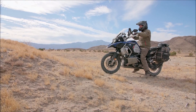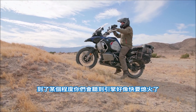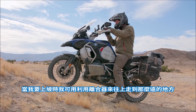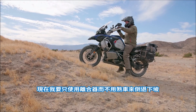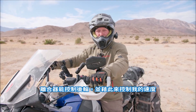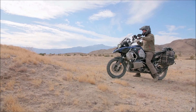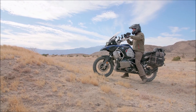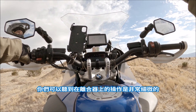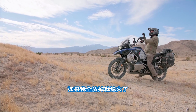You can see my hand is not on the throttle, just the clutch. Very small movements. As soon as the bike starts to move, leave the clutch right there — don't pull it in, don't let it all the way out because you'll kill the bike. What you'll hear is the engine about to die at a certain point. As you can see, I'm on my tiptoes. So now you know the point — that's as far out as I can let the clutch to keep the bike still rolling while I get up this hill. Now I want to roll back down this hill without using my brakes, just using my clutch. Just small micro movements on the clutch — the clutch is controlling that rear wheel and controlling my speed. You can hear just little micro adjustments on the clutch keeping the bike stable, not making it out of control. If I pull it in too much, I get out of control. If I let it go, it dies.